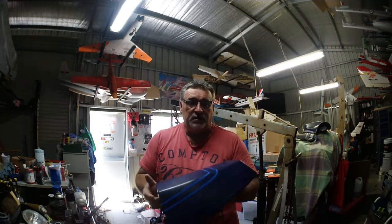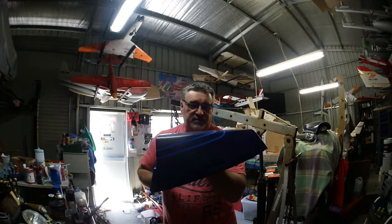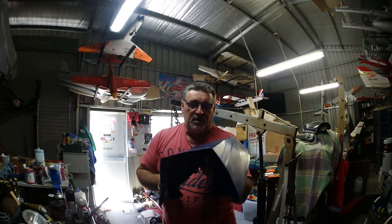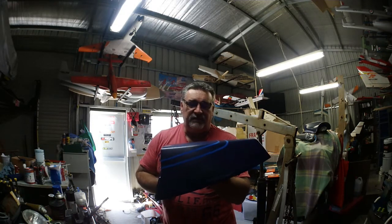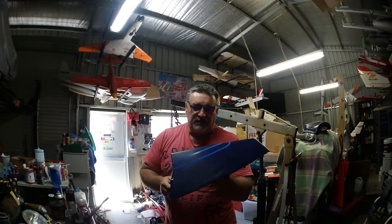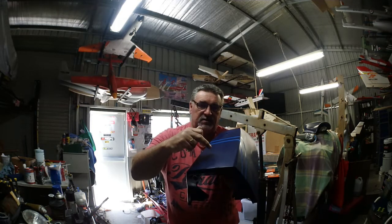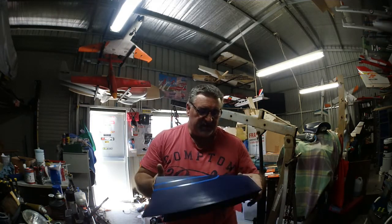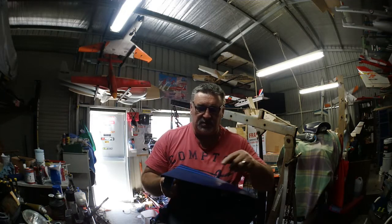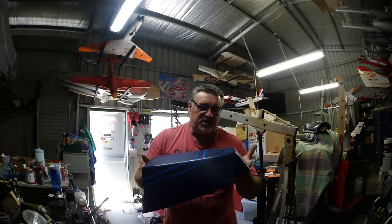Hi guys, I just wanted to have a quick talk to you about some of the stuff we're doing, which is this back panel. You've seen it on the bike. I have colour sanded this, which is something you don't do a lot of. There are two reasons why I've colour sanded this. One is that this part here on the top has got to be painted white, and the other thing is that any little blemishes, for instance there's one here, you can sand out at this stage.